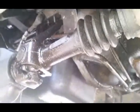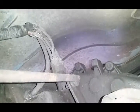So our next step here is going to be unbolting the front drive shaft, the four bolts up there. And the four bolts right there. Now that breather keeps it nice and lubed up, huh? Then after that, then we can take the linkage right there, pop it out. Then take the, where are they? Yeah, take those vacuum lines off. And then start unbolting the transfer case from the 47 RE. So that's what we're gonna be doing.